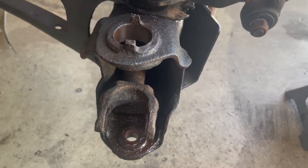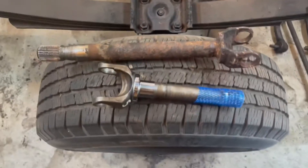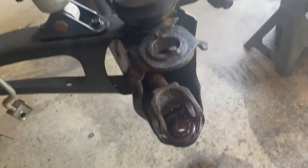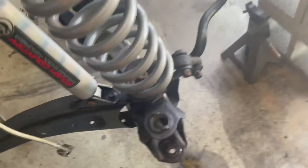We've been working on the passenger side. We cut both the ball joints and got that knuckle off of there. I gotta press the ball joints out of there, then I'm gonna send both knuckles to go get sandblasted. I just gotta figure out how to get out these U-joints that are shot and get my new outer axles on and new U-joints. Hub, rotor, everything — I got it all over here.